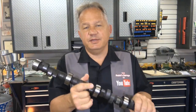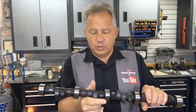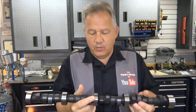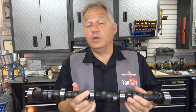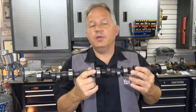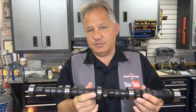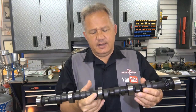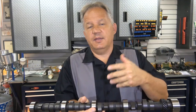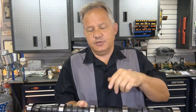Here's the cam for this engine and the owner chose a flat tappet cam, not a roller. There are some distinct differences you should be aware of when choosing a camshaft — I know there's millions of articles on it, but here are some of the basics. The flat tappet cam lobes are actually on a slight angle, and the lifters rotate around in this versus a roller which is actually straight.